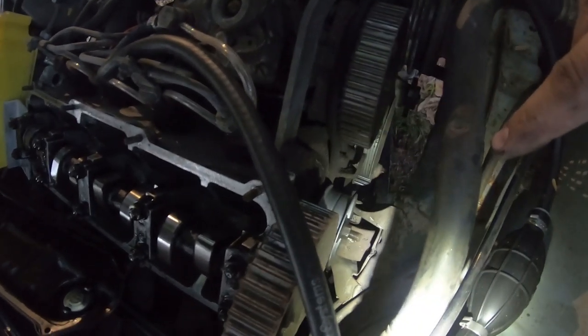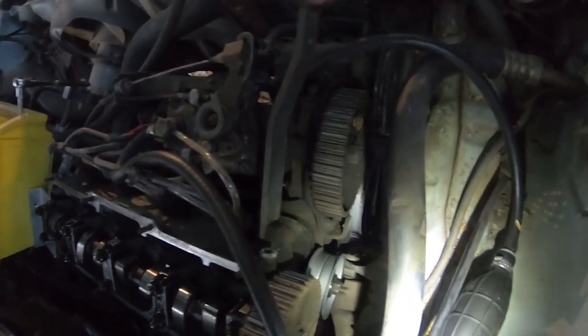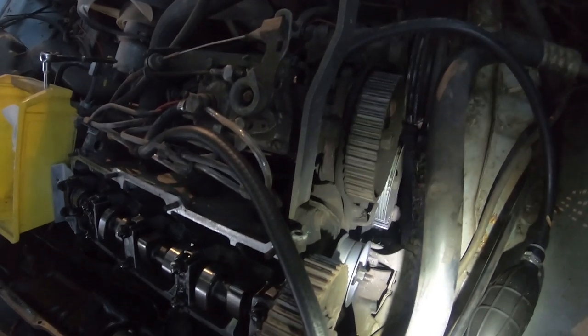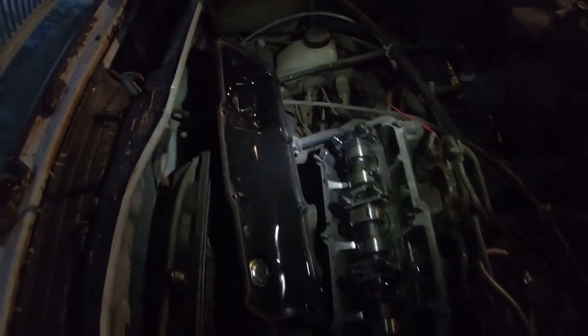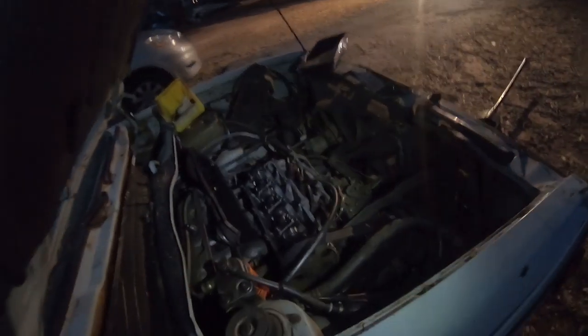All right, I'm gonna go ahead and let this back down, get our motor mount bolt back in, throw the belt on. Let's check all our marks and I'll catch you guys in just a second. All right, our mark there, here, and down here. Our line back up. I've gone ahead and snugged up our tensioner